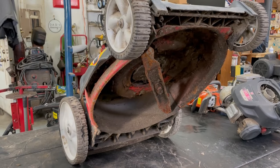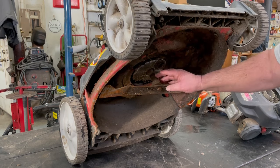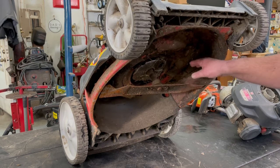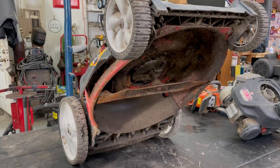I'll go ahead and take the blade off, then we'll unbolt the three bolts to the motor. When you're switching motors, always make sure that the diameter of the PTO shaft and the length are the same, because these decks are designed where the blades sit at a specific height for maximum vacuum or mulching, whatever the deck is designed to do. I'll go ahead and pop that blade off - that's a five-eighths on the MTDs.